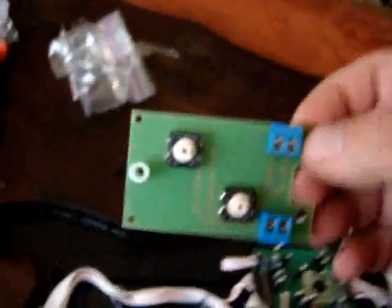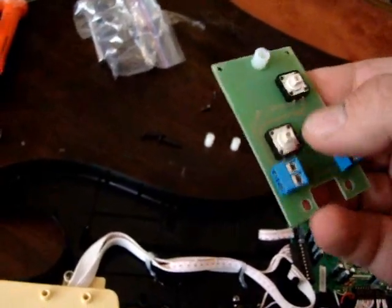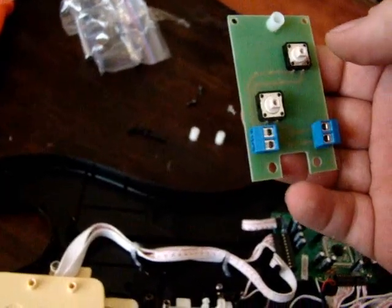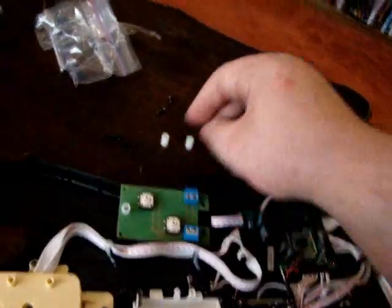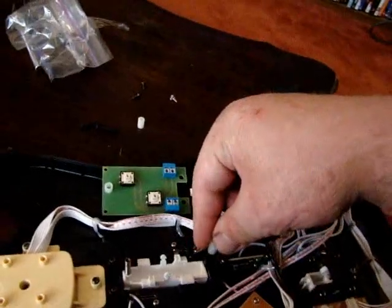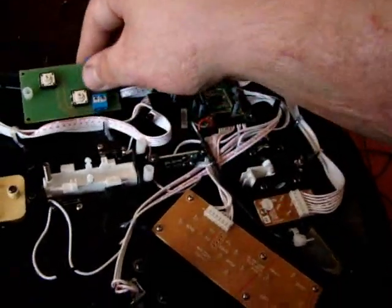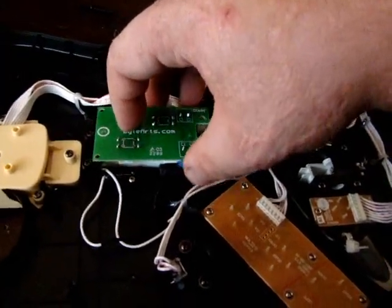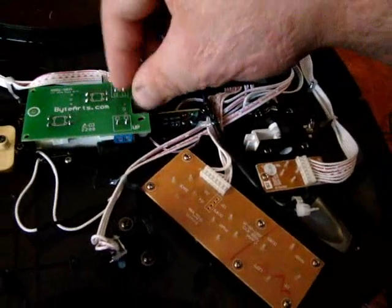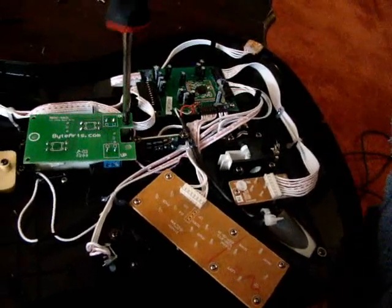The strum bar comes wrapped in bubble wrap, very neat and very tight. Here's the strum bar — it's a very unique piece of electronic circuitry. The micro switches: I've got two that I've been using with more than likely six or seven hundred hours invested between those two strum bars, and I've yet to have a single failure. These little nylon bushing pieces go right here and here. Take the long screws and run them right down through those nylon pieces and mount it where those two black screws came out — these support the strum bar itself.